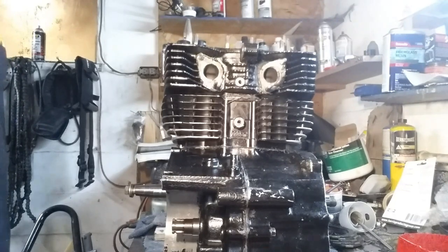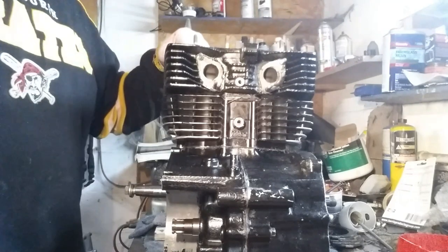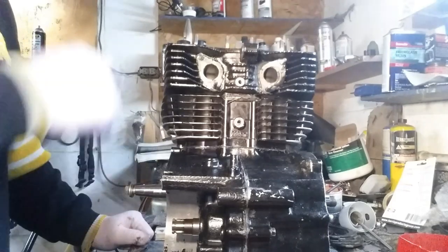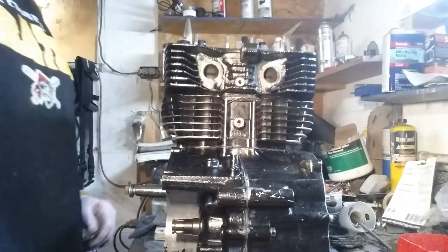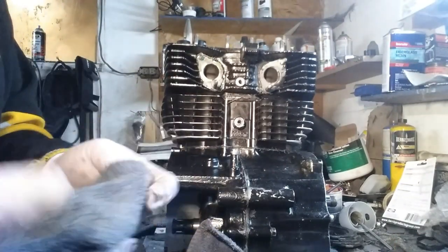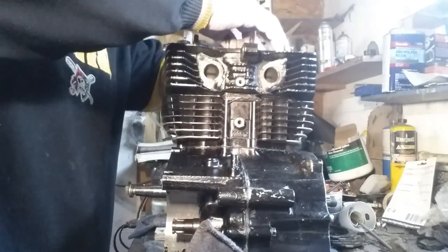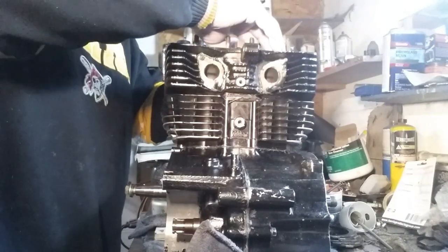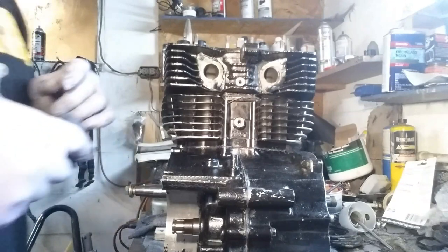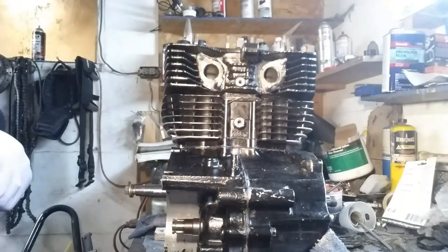You know what, I should have cleaned the top of my cylinder head — I didn't clean it but I'm going to have to clean that with cotton. So now what we're going to do is we're going to temporarily put our lifter housings on and bolt it down so that my gaskets will be smashed and sealed. Okay, what I did guys is I made miniature rags because I'm going to stuff anywhere a bolt can fall in, because if I drop a bolt inside here I'm possibly going to throw this motorcycle in the garbage.